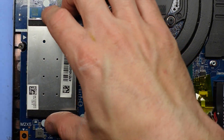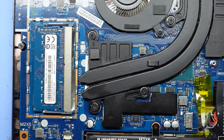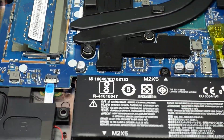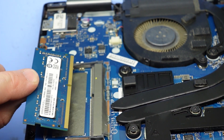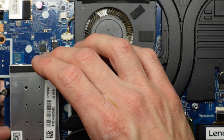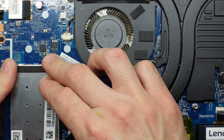Under here I'm assuming is some RAM. We've got a single 8 gig stick of DDR4 in there at the present. I'm not really seeing anywhere that looks like there's extra RAM, so that may be the only stick. If we were to upgrade it, we'd pull these tabs out, the RAM slots up, and then pull it out. There's a notch in the middle — when you go to reinsert the new stick you slide it in, push down, and it should click into position. You just need to line it up at all angles as the clips clamp it into position.